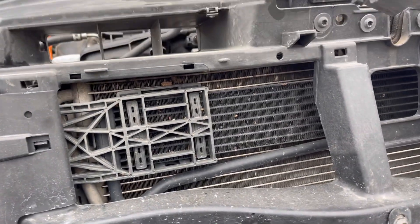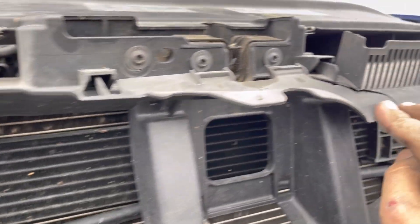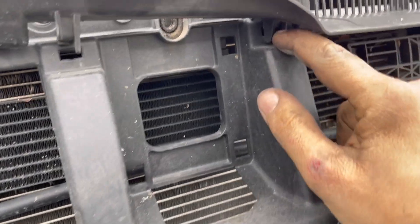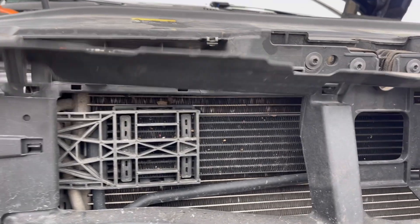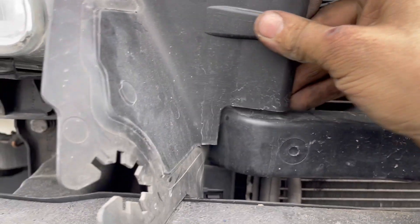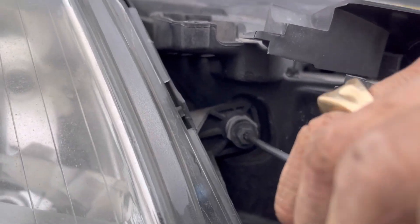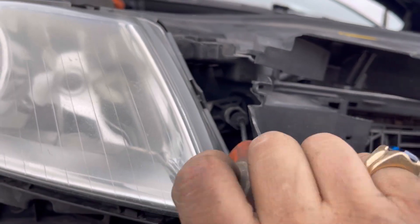I don't really need to get all of this loose, but it wouldn't be that hard — this was already previously broken, so I didn't do that. Maybe if you wanted to not take a chance on breaking it, don't pull this back too much. You want to get this trigger loose, and then there's another one on the back there. I'm assuming if you get these three loose, that should be enough. All you really have to do is get to this 10mm slash T30 right here, and then this one goes all the way down into these radiator supports. This is a T30 — don't tell Matco Tools, but I just got it loose with my T25 because it was already in my hand.